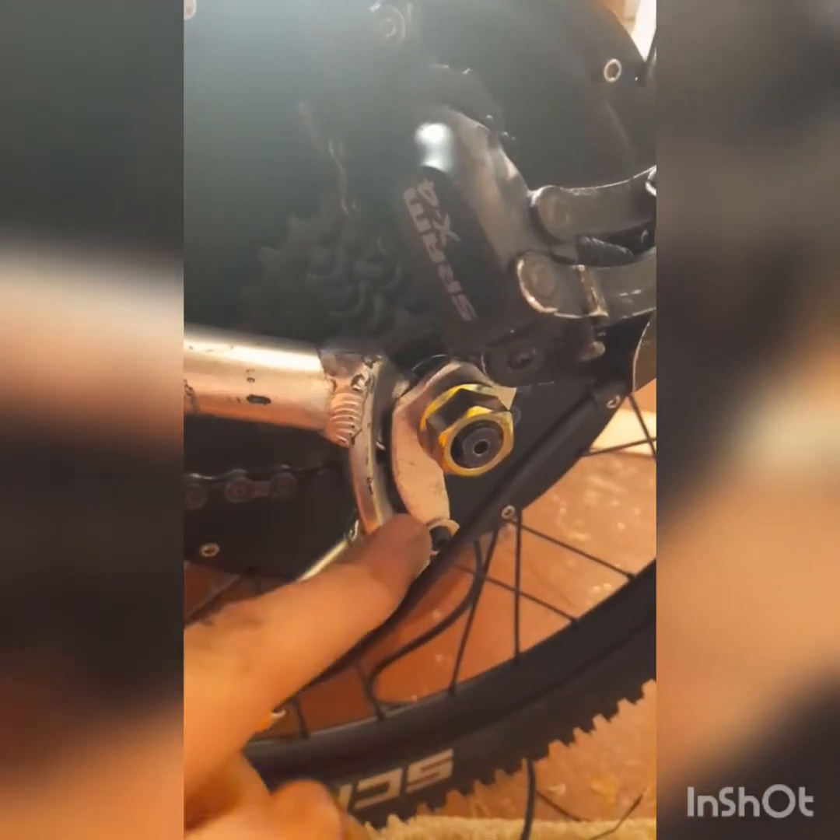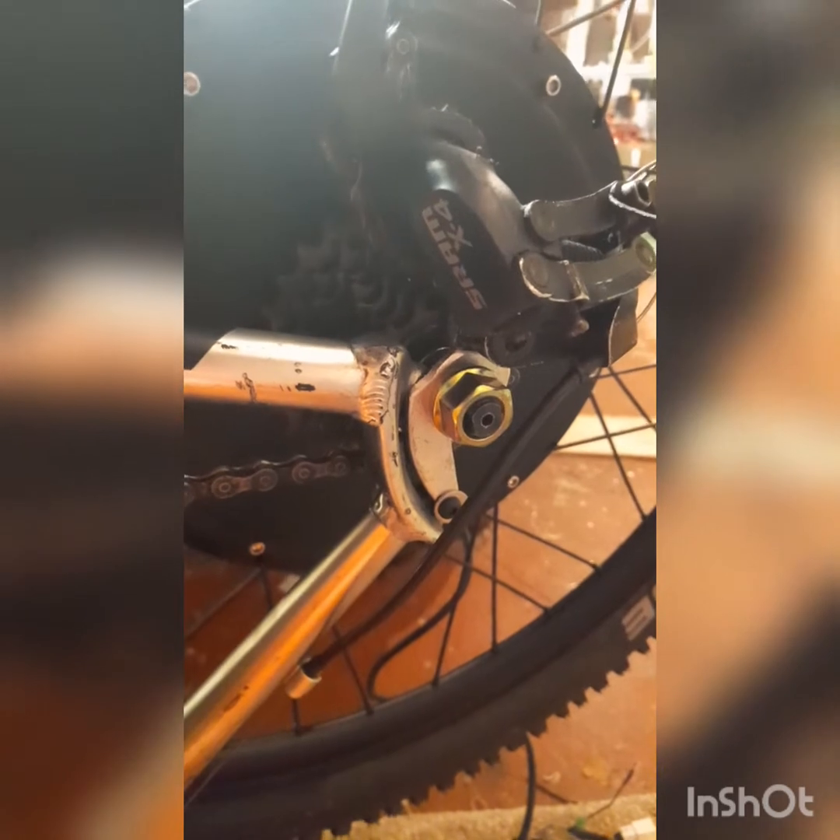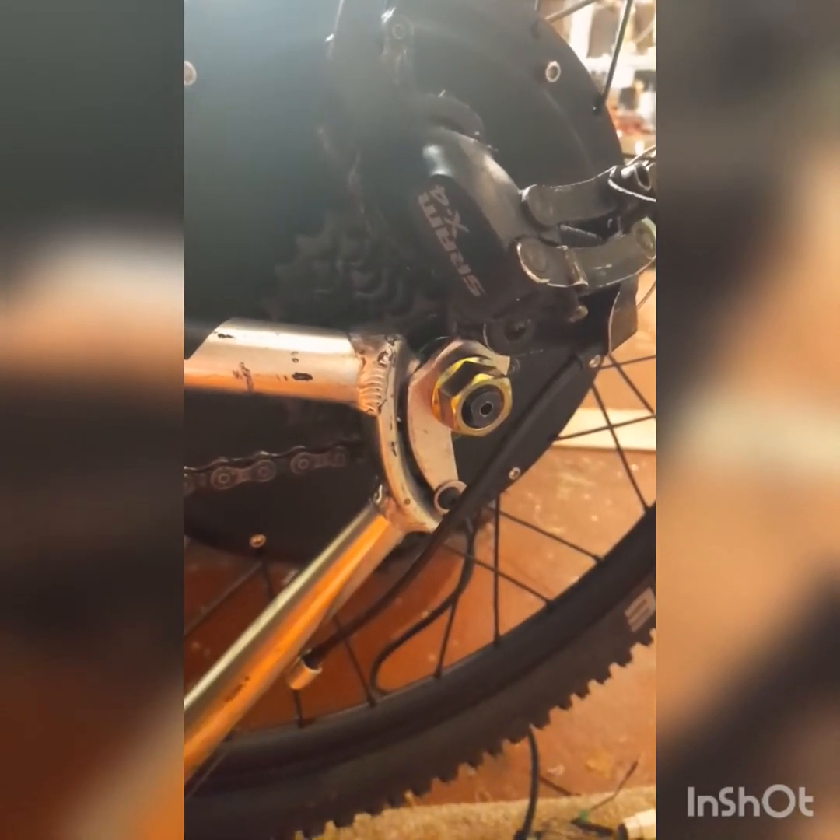So that's the other side done. Don't expect them to fit first time — I had to take an extra piece off the top so it fits underneath the derailleur mounts. There's a little piece in there so it sits on a little lip on the frame, but everything now when going that way is all pushing against your main frame, and you've got the lip of the washer behind that aluminium as well. I'm going to tighten that up, flip it over, and we'll have a look at mounting the battery and wiring her up.